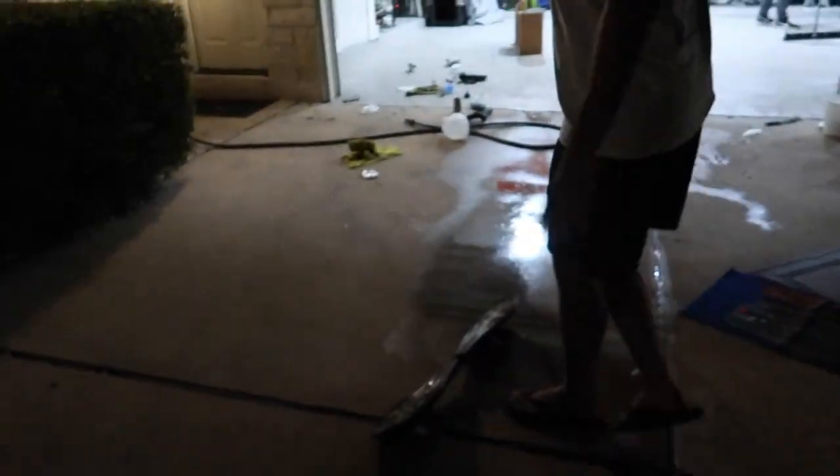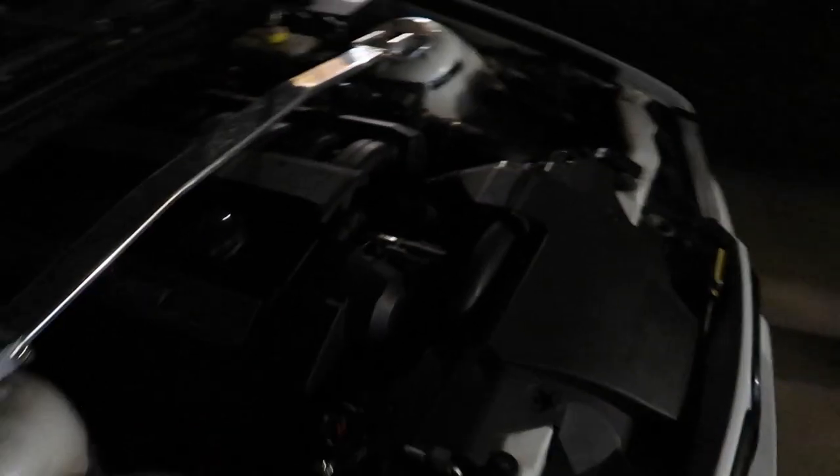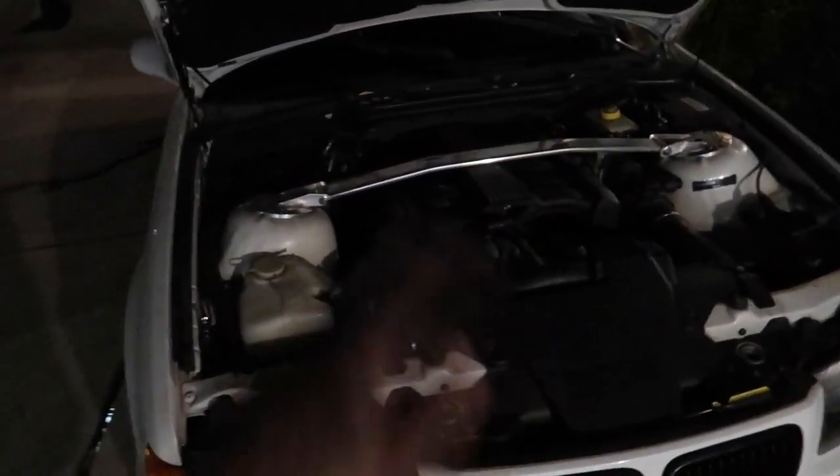It's all done. We basically burped the coolant — making sure there are no air bubbles in the coolant. Like I said, Menace has a really good process on how to do it all — definitely check it out, I'll put that in the description below. We just took this thing for a test drive, took it easy, drove around for about 10-15 minutes. It absolutely stayed at operating temperature — no issues whatsoever.